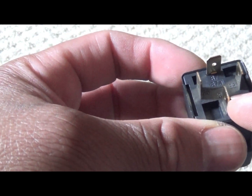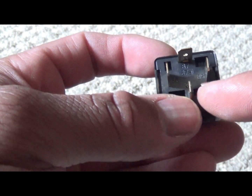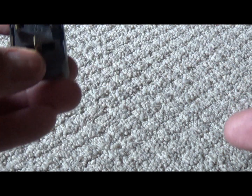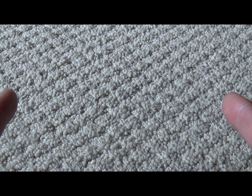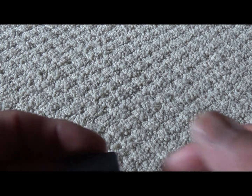This is going to be straight to the battery. This is where you want the fuse at, on your 30. Short as possible. Get down, come out about yay long. That's about 6 inches or so. Put your fuse right there, boom. Then you run your wire to the battery.